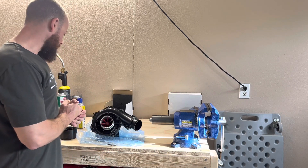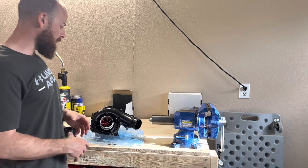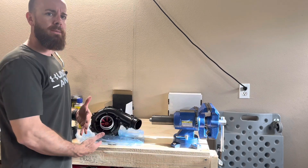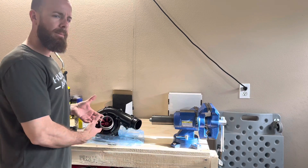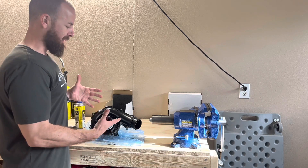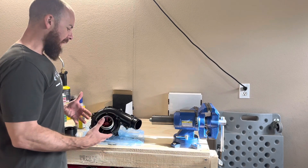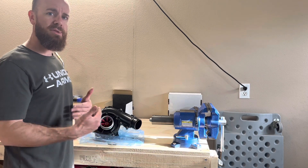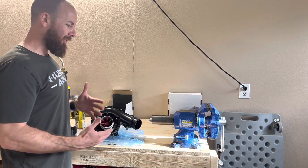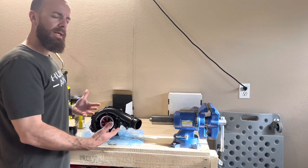Checking the slip again — we're at a little over 15, which is right where we want to be for a brand-new supercharger. It's going to loosen up a little over time and put us right around where we need for the RPM we'll be running. It's going to take probably about two hours of heat cycles for it to really settle in, then it should be pulled back off and checked. I've only seen them lose about two to three foot-pounds of slip. Since we're at a little over 15 and shooting for the 12–13 mark at around 8,200 RPM, I don't see any need to send it back to have slip adjusted.